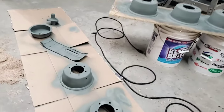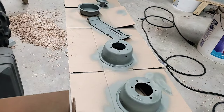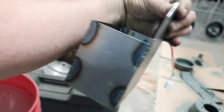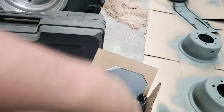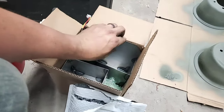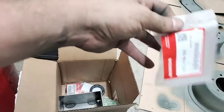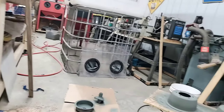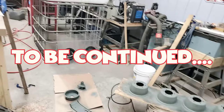I haven't talked about these yet. I'm putting a 110 motor on this 70 and it is electric start, fully auto. There's a local guy I just got introduced to the other day and he fabbed up a battery box. I'm using a battery out of a TRX-90 and I hope that's big enough. This holds the solenoid — pretty excited about that. I got new tank rubbers because the other ones were non-existent — these are still available right from Honda. There are the seals and bearings for the rear end. That's it for this very moment — really need this thing to come together.